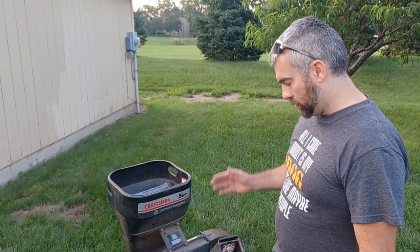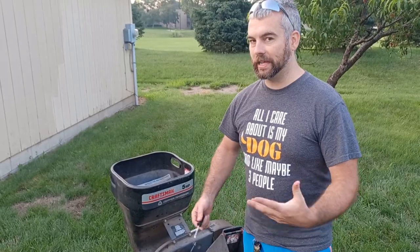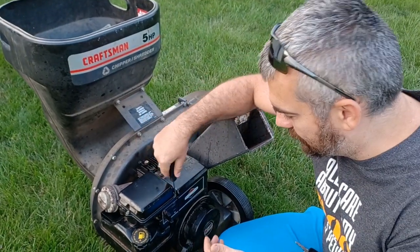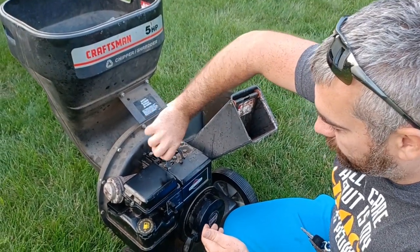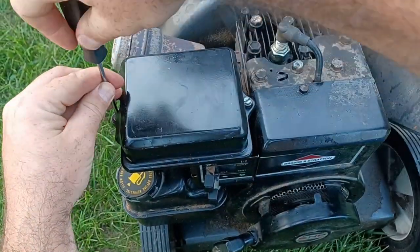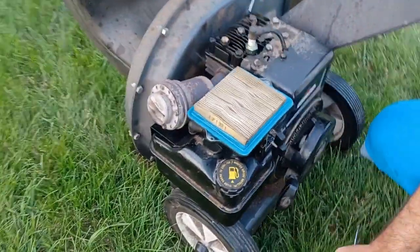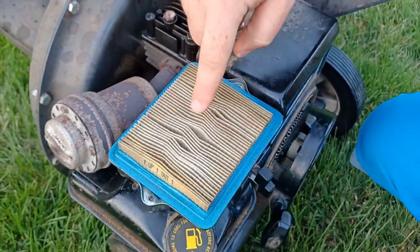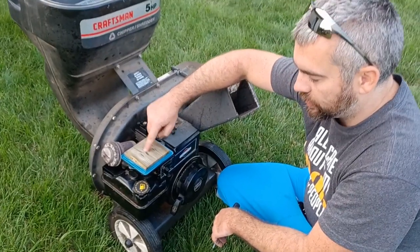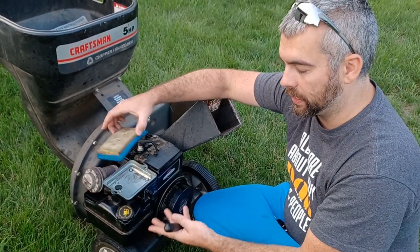This one will not run right. I changed the fuel pump diaphragm and put it all back together, and I didn't think about checking this. If you take these two flathead screws out, there is your air cleaner. This air cleaner is showing signs of being sucked in — when it gets sucked in it causes this accordion-like effect where it makes like a Z shape or a zigzag.